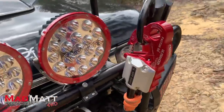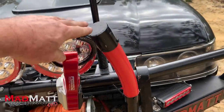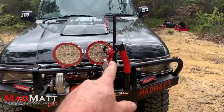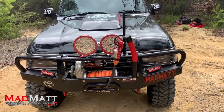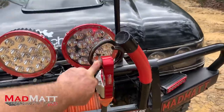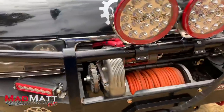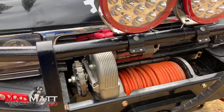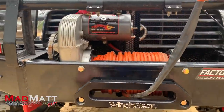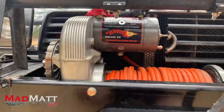At the front here we've got the Ultra hook from Factor 55 as our hook. We've got our winch rope guide here — the idea is when the navigator hooks the hook onto there and he's jumping back into the vehicle, I'm spooling it in with the in-cab controls until I see this start to dip down, and I know that I'm at the end of my winch rope — but it also slows the winch down. The winch is a Warn 8274 high mount winch, but it's been completely beefed up. There are two videos out there about it. It's been completely beefed up using Winch Gear products from the company Roadrunner Offroad.